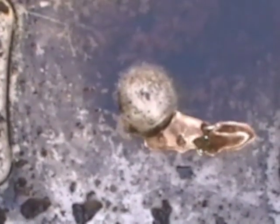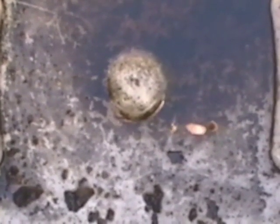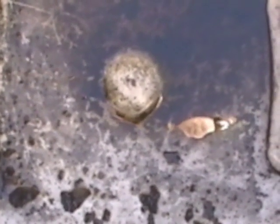This is some of the sludge that came from my blending experiment with B99 biodiesel with gasoline added to it at about 90%, and you can see those big chunks at the bottom are what came out from the biodiesel after adding the gasoline. So I'm very glad that I filtered this blend before I put it into my fuel tank, or all that would have ended up stuck in my fuel tank and eventually stuck in my fuel filter, and people would have said, oh yeah, the reason why your fuel filter plugged up so quickly is because biodiesel is such a good solvent, it cleans your fuel tank out.